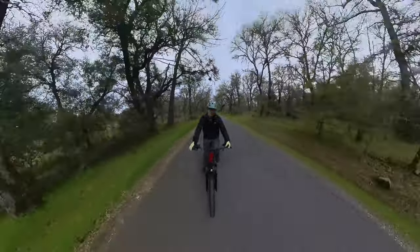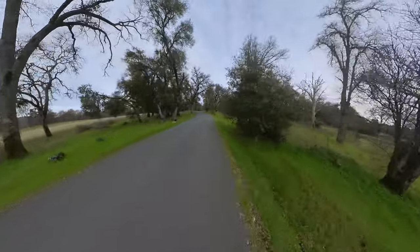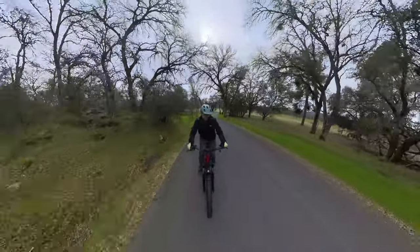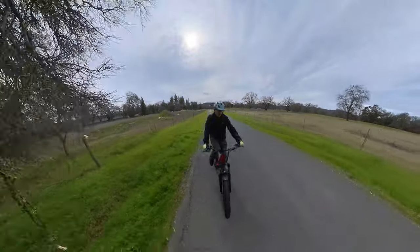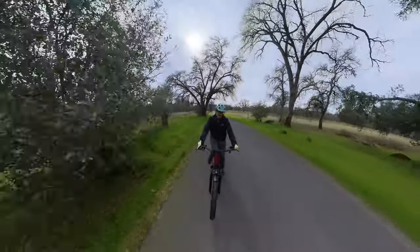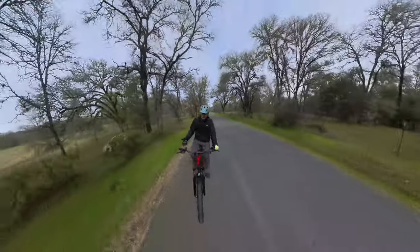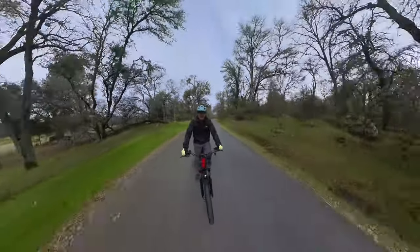I just remembered that the bike shows power in watts on the screen, so I'm going to turn around quick and check. On pedal assist 1 it's giving me an extra 400-some watts. Pedal assist 2 is around 460 watts or so. If I just hit full throttle from right here — 975, 1000 watts for a second there, 997, 996. So peak power pushing up a hill is actually about 1000 watts. We're going to lose a little efficiency from the motor, so we're not actually getting 1000 watts to the ground, but I bet when we put this on the dyno we get over 900.